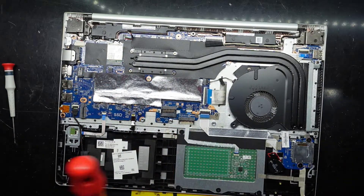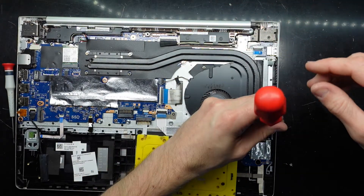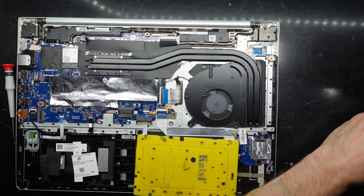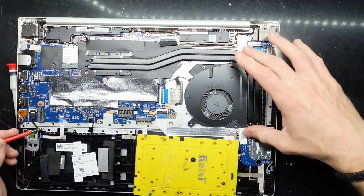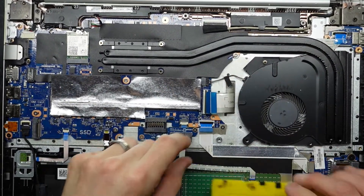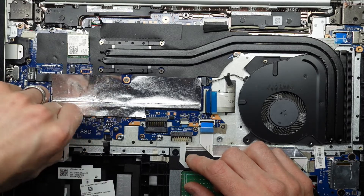One stubborn battery. We have to have this weird little bracket here — I don't know if it's there for acoustic reasons or if it's meant to help keep the copper cooler down. I want to disconnect up here as I'm leaving that cable connected on the mainboard, and then I'll slowly work my way back. Disconnect the keyboard, disconnect the daughterboard, backlight LED, fingerprint reader.